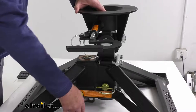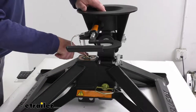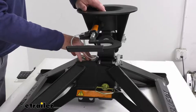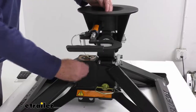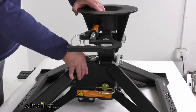This does not go into the hole — it goes on to the gooseneck ball. Right up here, this nut you'll tighten down to a certain torque spec to keep it in place. Basically, this is your connection to your gooseneck ball, and right up here is your connection to your kingpin, so you're actually gaining an extra four inches of clearance when you install this.